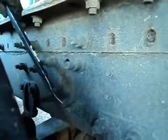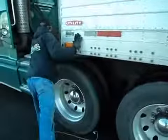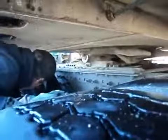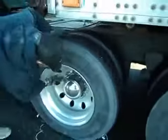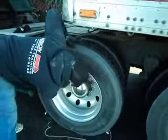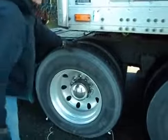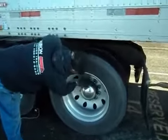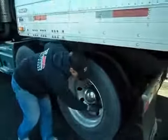The next thing I'm going to talk about is the frame — there's no cracks in the frame. And then behind the tires here, there's leaf springs — check your leaf springs and make sure they're not cracked. After I'm done inside there, I'm going to do both sets of tires at the same time. From the middle I look at both sets: inside the tire there's no rips, tears, or bulges — even adequate tread across both, nothing caught in between. Then I go to one tire — outside this tire, no rips, tears, or bulges. No cracks in the rim. Lug nuts are all nice and tight. No leakage from the hub. No audible leak from the valve stem. This tire is done exactly the same: no rips, tears or bulges on the outside, no cracks in the rim, lug nuts are all tight, no leakage from the hub, no audible leak from the valve stem.